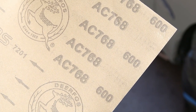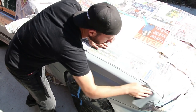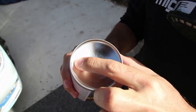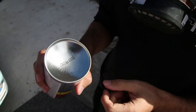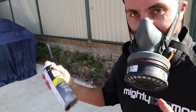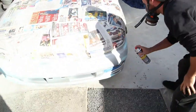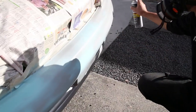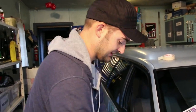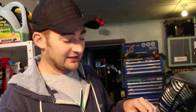We're giving the guard a light sand with 600 grit sandpaper to make sure it's smooth and ready for the base coat. A good tip when painting: shake the can until you're getting indentations on the bottom — you can feel them — and that means everything inside the can is ready to go all over your car. It's a good idea to spray a primer over the filler primer to make sure you've got good paint adhesion. The wind has picked up outside, so we've moved the car into the shed and we're re-masking some areas, because the worst thing that can happen is debris falling into your paint and ruining your mad paint job.